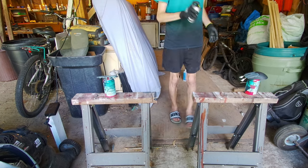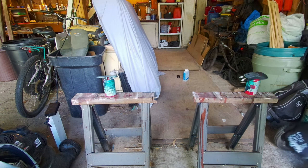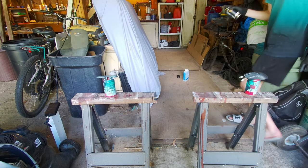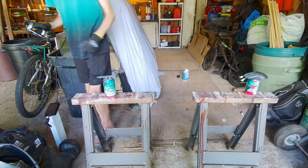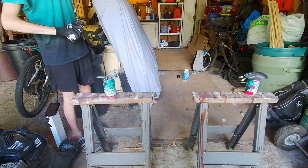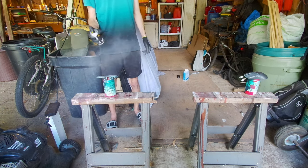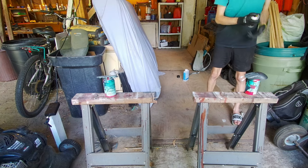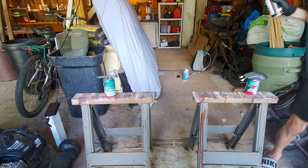Alright, so we're starting off with a metal base coat. My technique here is pretty bad, I'll be honest. It was from Crazy, or Custom Cans — they had me buy this stuff, which was a very shiny metallic base coat, before I put on the candy emerald. Beforehand, I sanded this all down, but I also had to dip it in mineral spirits just to get any excess oil from my fingers or anything off of it, and any other fine dust from the sanding process.